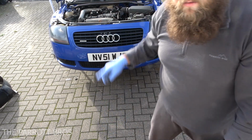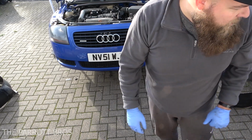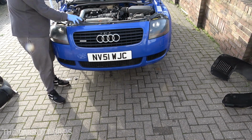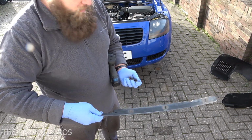Right, so that's the either side 10mm, 2, one on top of the other, by the front mounting intercoolers, side mounting intercoolers, apologies. Now we'll get the top 6 undone. The metal trim that sits on top of the bumper, just so you don't damage the bumper when you're fixing it down, along with the 6 fixings.